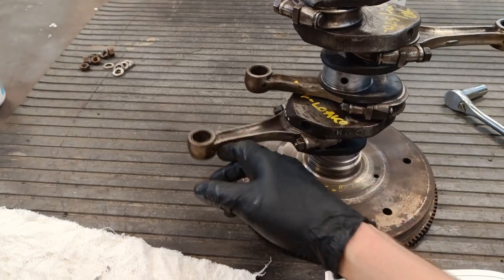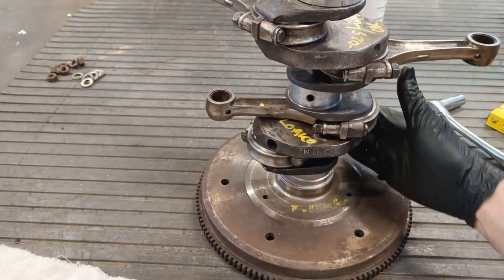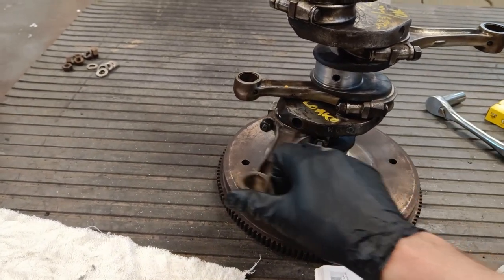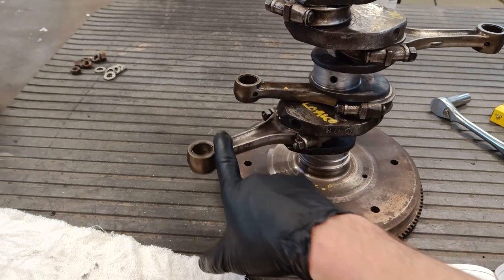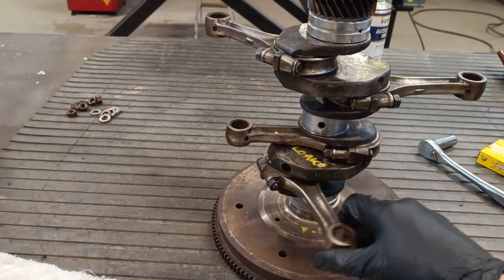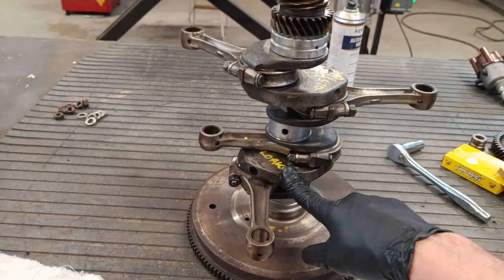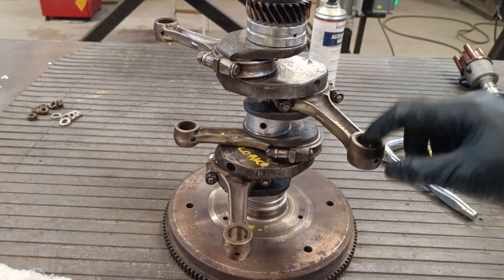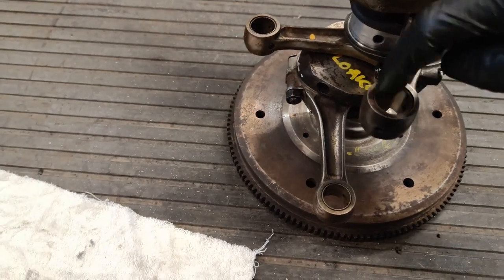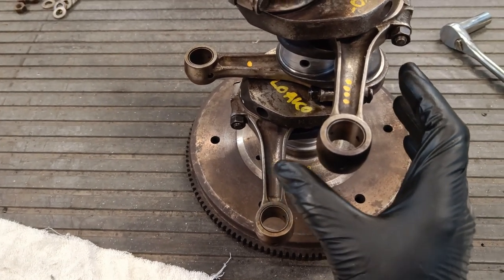You would not believe the problems I had with the other engine I built. I think the first crank I had was bent. Well, no, it was actually when I put it in the engine and then put the case together and tightened the case a little bit, then the crank had a tight spot, so it was bent. So I measured it, realized it was bent, had to buy a new one. Then there's another thing I haven't talked about, which is these. This is where the gudgeon pins go, which hold your piston on, which we will cover in a later video.